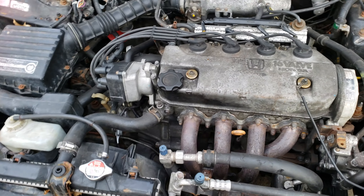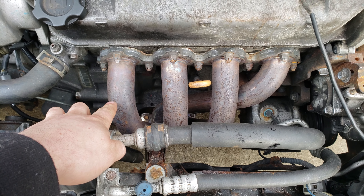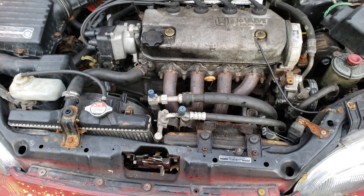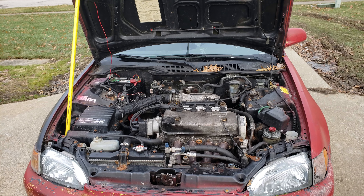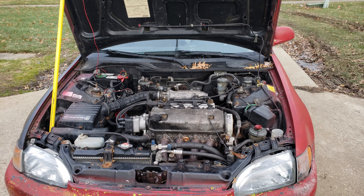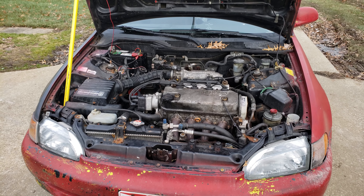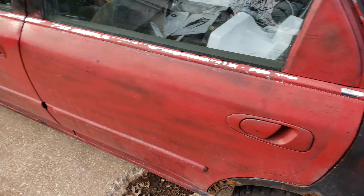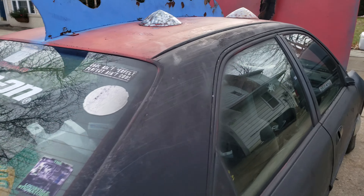Some upgrades I did to the car — not really upgrades, just because I wanted to do it. I put this header on probably about eight months ago. It's really cheap — it was like 76 bucks — but it's better than the manifold that was on it. I just recently, since this is a '94 and I live in Ohio in a county that has e-check, it turns 25 in January, January 1st actually, and I just got rid of the cat. So it's got no cat. Basically all the way back it goes header, it's a straight pipe. I've got a resonator in there but it really doesn't do anything. And then it comes out to this four-inch tip, so it's definitely not very quiet. I mean, if you're gassing it, it's pretty loud.